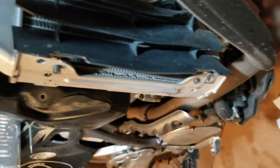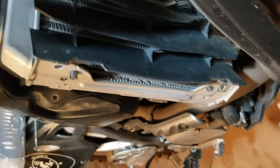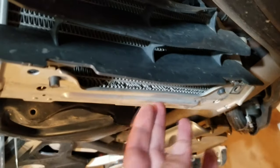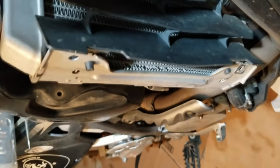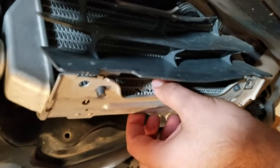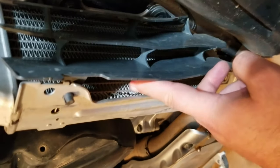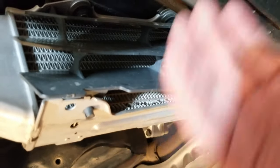So you can see right there that the radiators are kind of collapsed in on this side, which isn't fantastic. The radiators do have a relatively thickish piece of aluminum on here to kind of protect them. But there's only so much that the stock radiator is really going to protect you from. And it is what it is. I'm not going to replace these radiators, especially this one's the worst, because of the flow of the inner parts. So fluid from the radiator flows through these channels here on the inside, and then these fins are what dissipate the heat as air comes through.